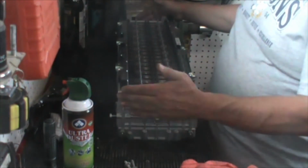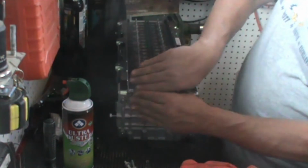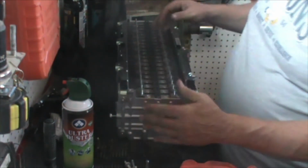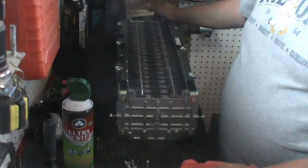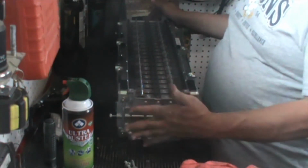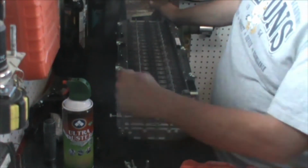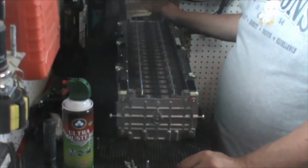They want it to be really strong with a lot of even pressure. We don't want that plate to bow or bend either horizontally or vertically. So by having 4 points of contact, we can manage that from all sides. The end plate should be steel or aluminum. And we'll talk a little bit about the dissimilar metal issue with having steel that goes through into an aluminum body. We'll get into that in a minute.